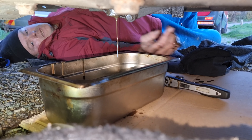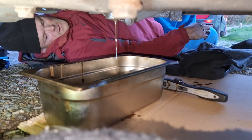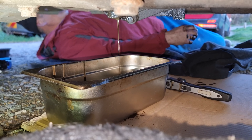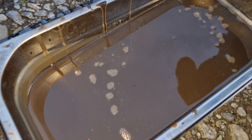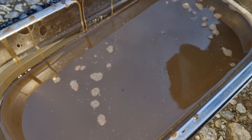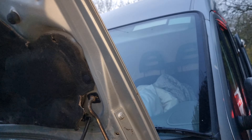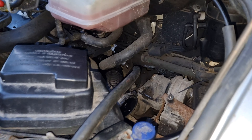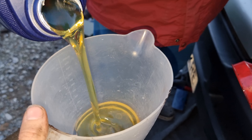The old oil is a browny, creamy white colour — like a light brown, like hot chocolate. That's all that was in there — about 2.7 litres. That's our old oil and it looks like chocolate. We're thinking water has been getting in there from the windshield — it's a common fault. It drips down off the windshield, goes on top of the breather, and goes into the gearbox.